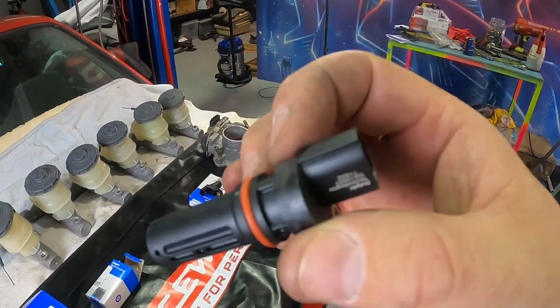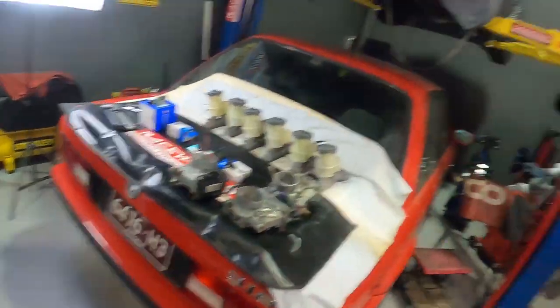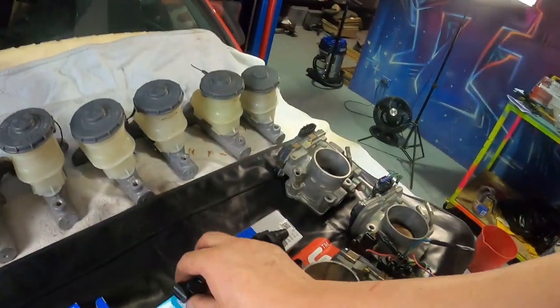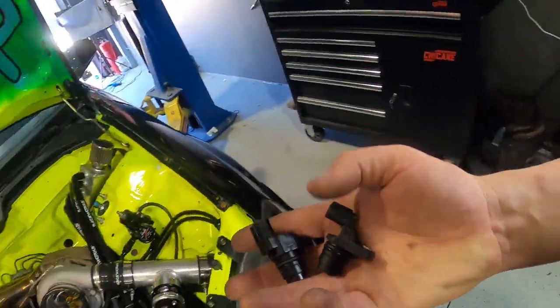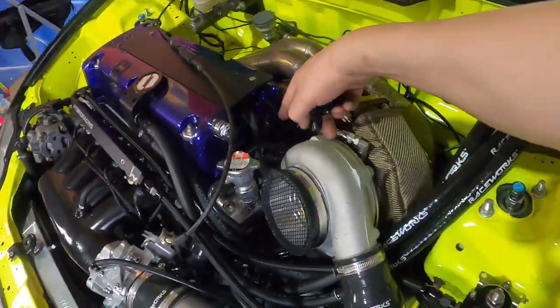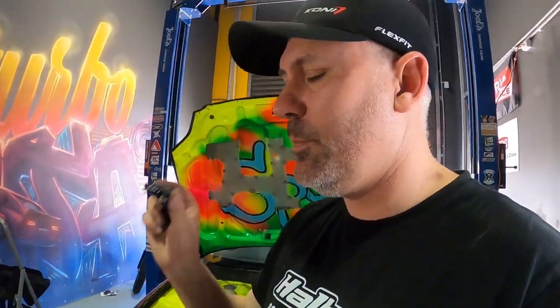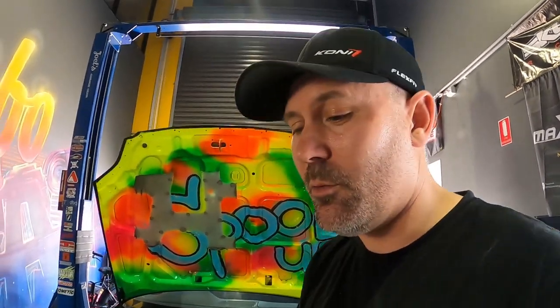Most of these have a 25-degree cam gear — you can swap it to a 40 or a 50; I went all the way with a 50. Next is the Hall effect sensor, which is your crank trigger wheel sensor. It lives underneath at the bottom of the engine near the balancer — I'll show you that once it's in the air. Then we have these two cam angle sensors — intake and exhaust. Very important: put them in the right way and use the right plugs. When I first started the engine I had them around the wrong way and it sounded really angry, like it was cammed. I swapped them over and now it runs smooth as butter.